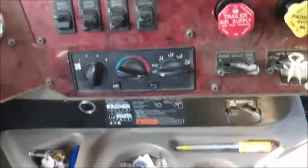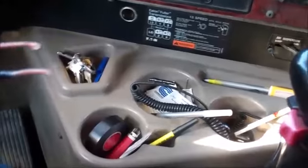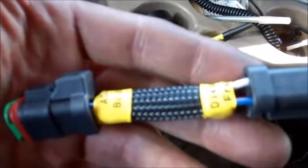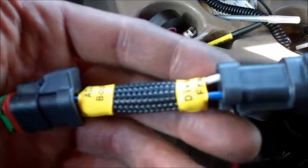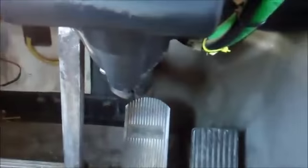And I prepared this one. See, the guy told me, he says don't leave too much metal, so just basically 10 millimeters or a quarter of an inch. And now we're gonna go and disconnect the old one and plug this one, and then the old booster sensor harness will go in the other end, and then we'll just drag it through there underneath and hook it up here.